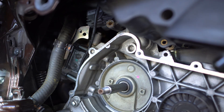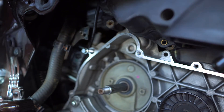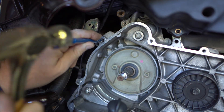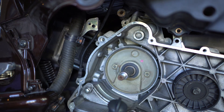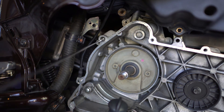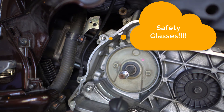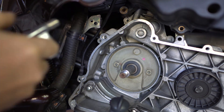Now what we can do is take a bolt — an M6 — and she should screw in nice and perfect. Last thing we've got to do before we go is break that tab on the end. There — it's gone. I'll try to get it with my magnet, or I'll blow it out again. Always remember to wear your glasses.